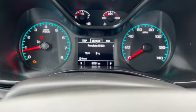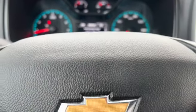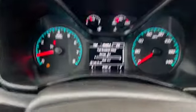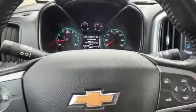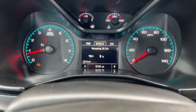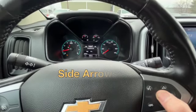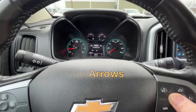As you can see, this is remaining oil life. You could be on a different screen on your meter, but if you use your cursor here, you want to get it on vehicle. You use your arrows to toggle through the trip, the eco, and the vehicle.